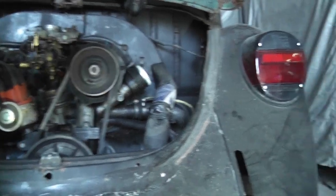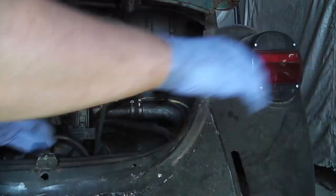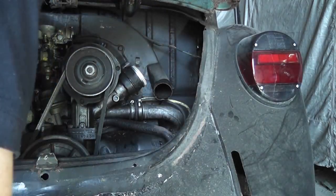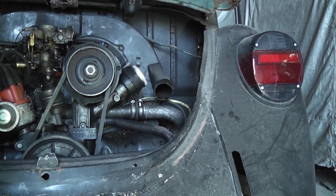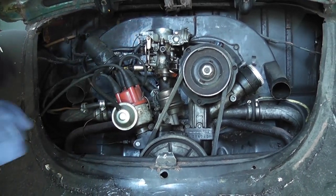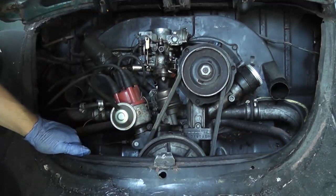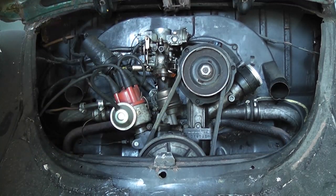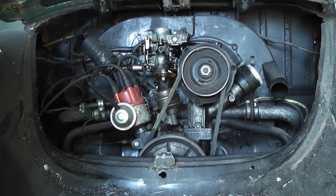That's one of them off. We'll get this one off here now as well. The main thing is, with no rear tin you don't really have to worry too much about the pre-heater tubes. One of the things that Darren was telling me was the fact that the car had a tendency to cut out. And when you have a Beetle cutting out all the time and it won't idle, a lot of the time it's because these pipes that come up from the exhaust on either side of the engine bay get blocked — they're heat riser pipes.